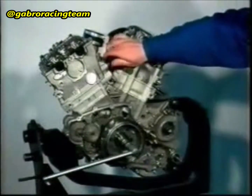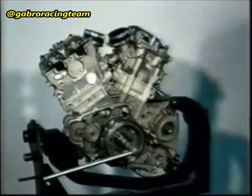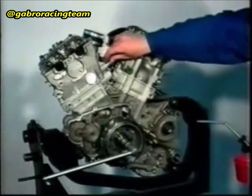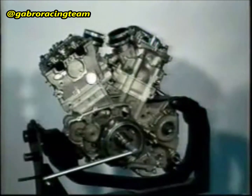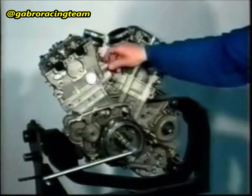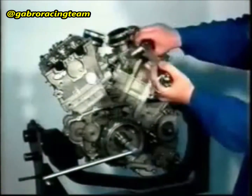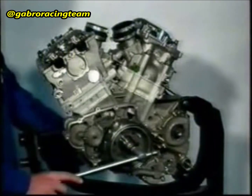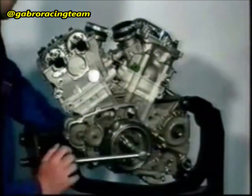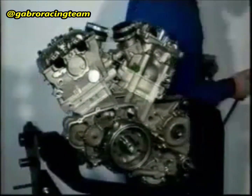Check the timing values on the comparator for the last time. Remove the measuring device from the head. Remove the tightening screw from the head. Oil the chain tightener and insert it with a closed part in the driving direction. Fasten the 16 by 1.5 locking screw together with the relevant packing ring. The tightening torque is 30 Nm.